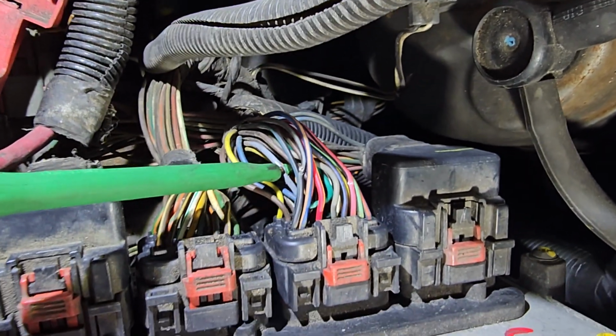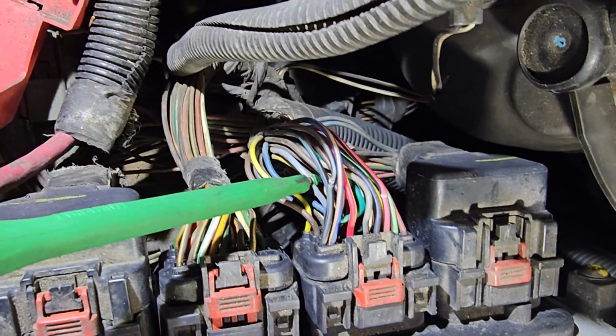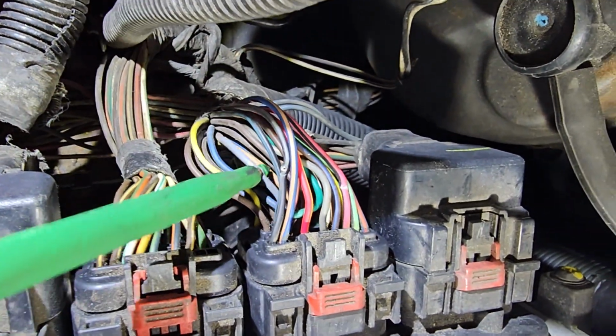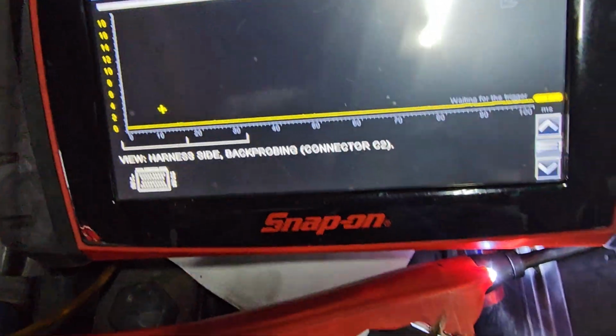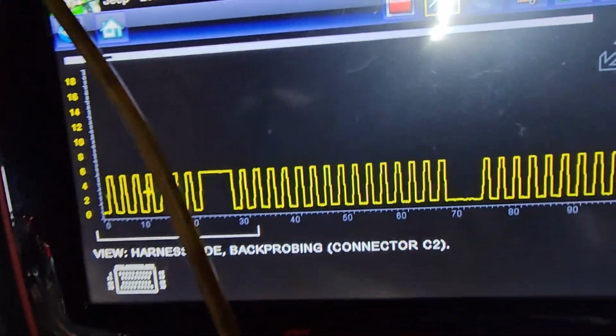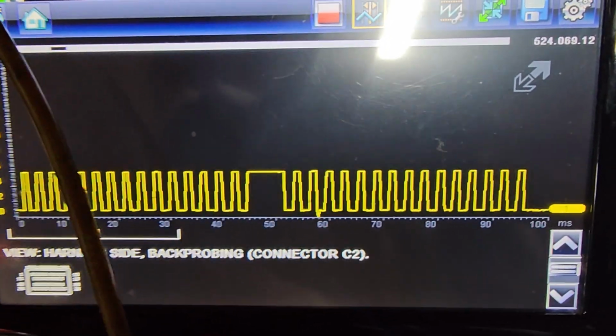But we say maybe let's check the crankshaft sensor wire. You see this wire here? Gray and black. That's the crankshaft sensor wire. When we put it in and we test it, you see here, without connection, we put one in the ground and we put by voltmeter. The good crankshaft sensor signal in this car, when the car is running, is supposed to be like this.